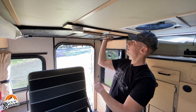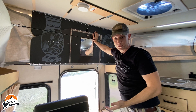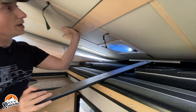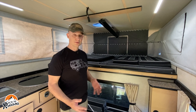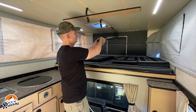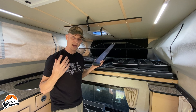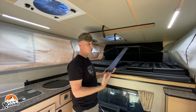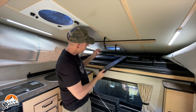To get the roof up, it's fairly straightforward. On the backside of the camper, lift it a little, pull the lock out, put your hand here and push up — that locks into place. On the front, undo the strap, and this bar is used to push forward and then up. When you're ready to break camp, it's just the reverse. Unlatch and pull. There's a bungee cord you can strap to pull the sides in, but what my wife and I actually do with our own Four-Wheel Camper is shut all the doors and windows, put the exhaust fans on pulling air out — it creates a vacuum and pulls the canvas in, which works better than the straps. Just pull down and the roof comes right down; clip it back into place.